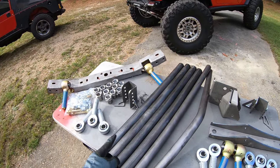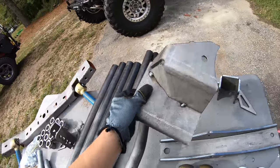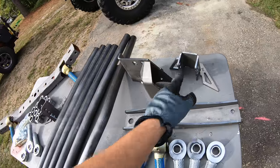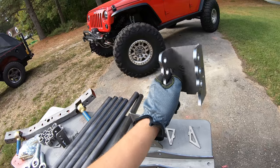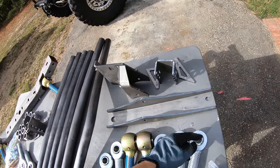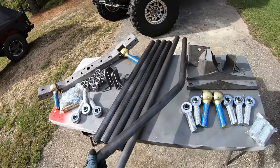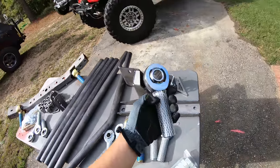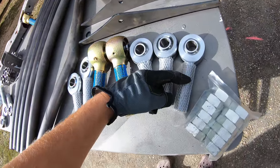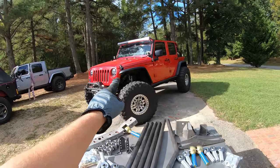DOM tubing is plenty strong. If we're bouncing around in crazy rocks there's a possibility of bending it, but since we're doing this ourselves it's easy to replace and remake. The rear mount — I already tacked this one up — is going to weld onto the frame, pre-jigged and aligned to make it easy. We're going to weld the upper link mount on top of our truss, and the upper link mount on the frame goes between the two cross members, right above our drive shaft. We have our long-shank heim joints from Barnes Four Wheel Drive — long-shank meaning we still have plenty of thread engagement and can make drastic changes in control arm length.